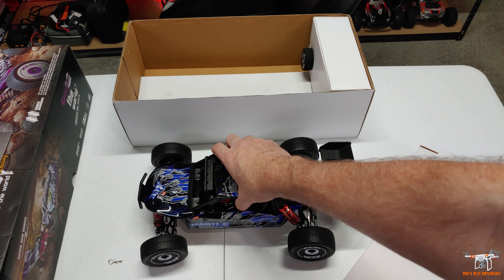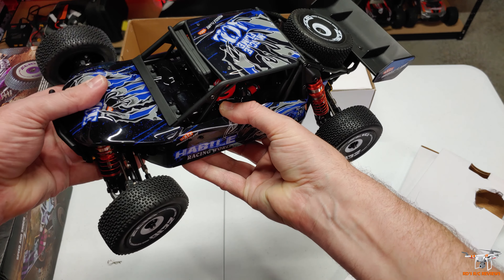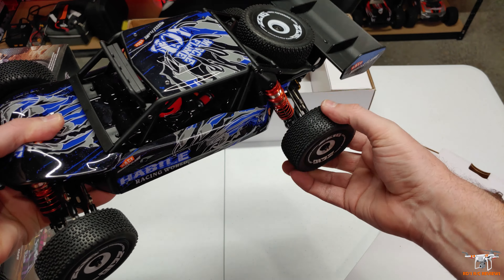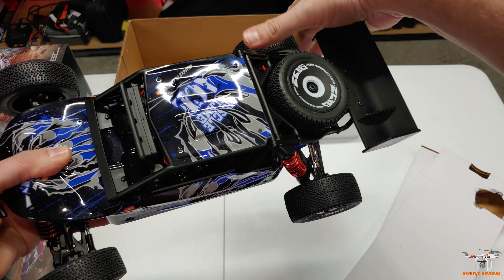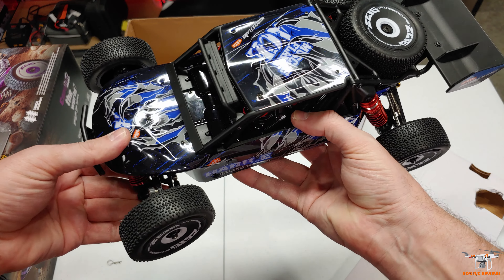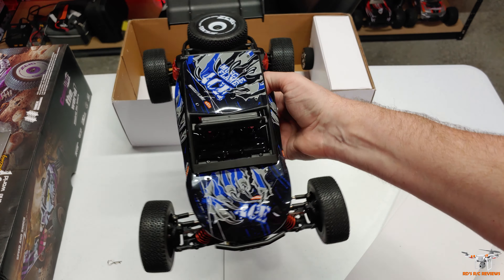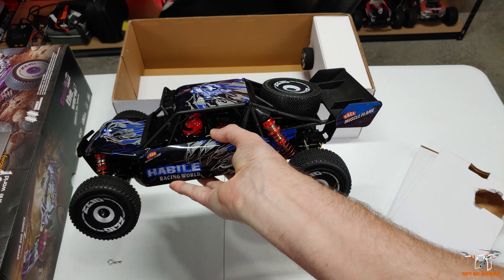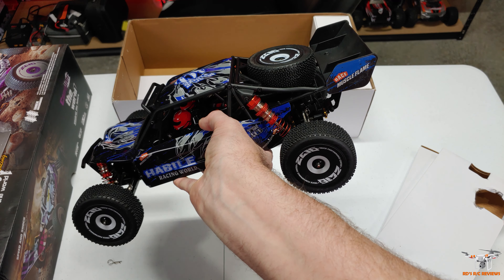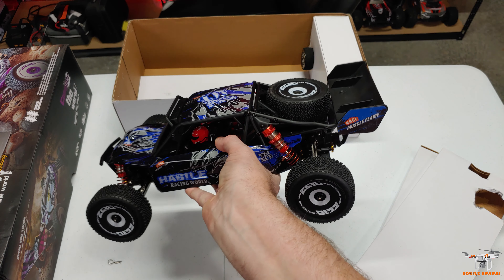Really good damping. You do oftentimes need to check these to make sure they have adequate oil and that they're not under-filled or over-filled. These feel pretty good to me — if anything, they might need a little bit of oil added. On some of these cars they come with too much oil. Donnie over at Big Drone Flyer 77 — I think his 19, the other version, was a little over-filled. If that happens, your shocks are going to be almost bound up and won't want to compress. These do not feel that way to me right offhand.